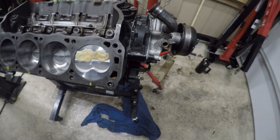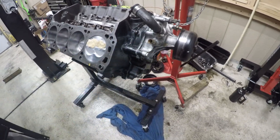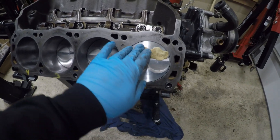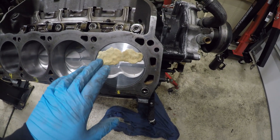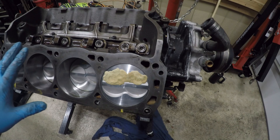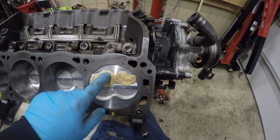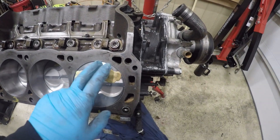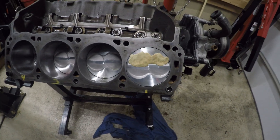We've moved on further in the build. I've put on the front timing chain cover and the water pump, but I didn't record that. What we're going to do today is check the clearance on the valves, put some plumber's putty here, and then we're going to use the old gasket - not a new one - put the head on, put two push rods, and then rotate the motor and see if I get any hits.